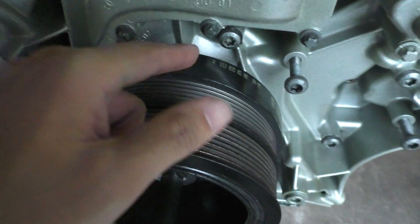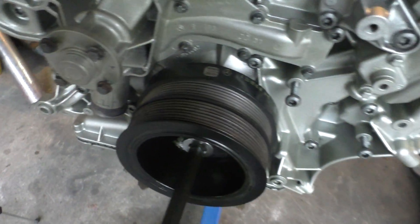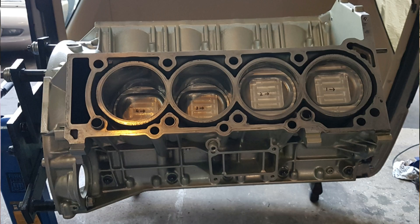But now you can see there are no degree markers on this side — there are only degree markers on that side. So what I'll actually do is take the values from cylinder four rather than cylinder one, because cylinder four is at 180 degrees of phase from cylinder one.